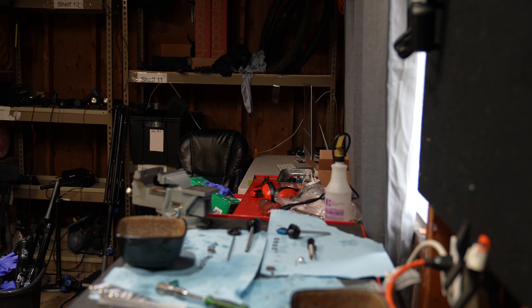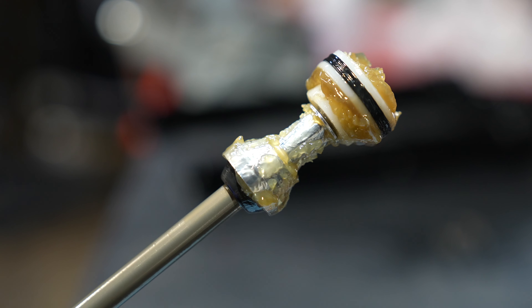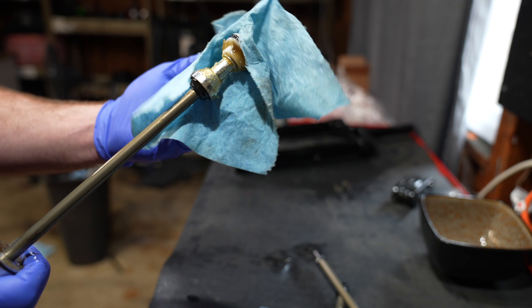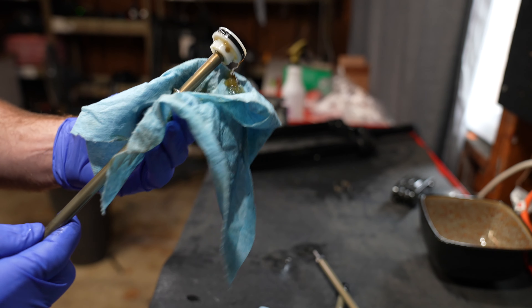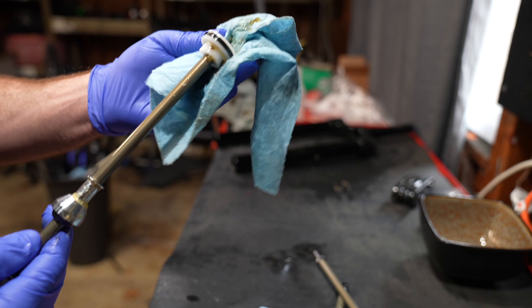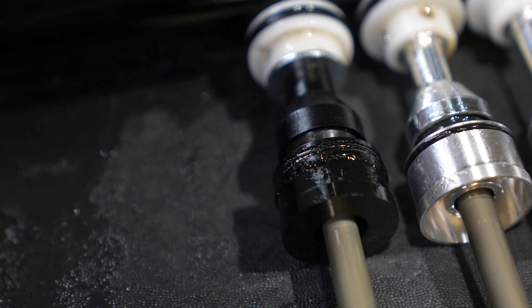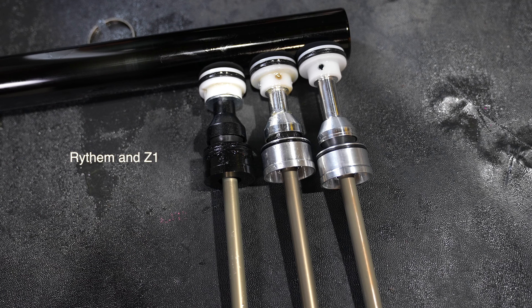Now let's take a look at all three rebound assemblies. The rail and the grip share the same piston. The grip 2 has a much more sophisticated rebound assembly because it has high and low speed compression — I'm guessing that's where a lot of the cost in this damper comes from. The part that pokes outside of the fork is all the same, so you can basically interchange the dampers in any modern Fox 36. There was a massive learning curve putting these three forks back together — I ruined the rail damper and the grip damper will not go firm on the compression lever.